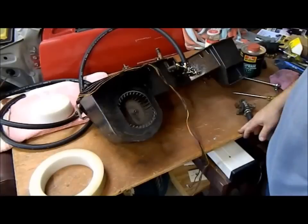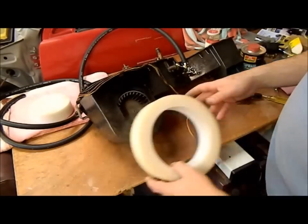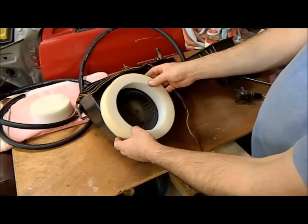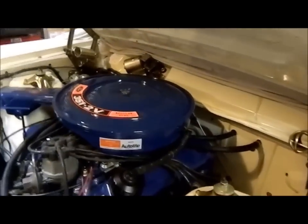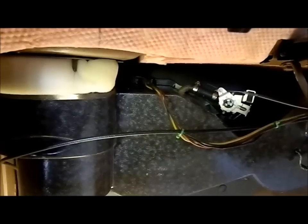We can clean up any excess mastic sealant with a bit of prep-sol solvent cleaner. We've nearly finished the heater box — it's got a new tap on. We used the old tap as a template and made the right length hose. I've got three metres of half-inch hose. That repair you can virtually not see — it is visible, but once you get it in there it's turned out very successful. I'm quite happy with that. The plumbing is in; I haven't got it connected to the engine yet because it's a different diameter — half-inch as opposed to five-eighths. Here's our lovely heater box with the heater tap — cold, hot, floor, and screen — all working well.